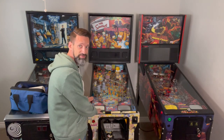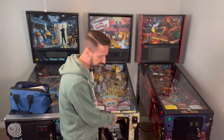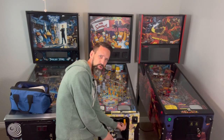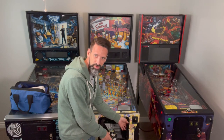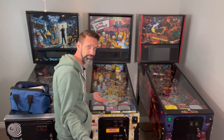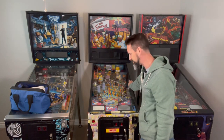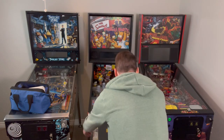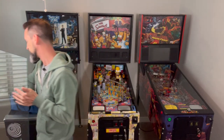The lockdown bar can just get pulled out and put out of the way. Then you're going to slide out the glass, but you've got to close the coin door before you do that or the glass is going to hit it. That's where that spring comes into play — some older machines have lost the spring, so the handle won't stay open, and you won't be able to shut the coin door. Make sure that yellow handle is pushed back, hopefully the spring is pulling it back, then lock the coin door again. The glass has little plastic trays — a guide it slides in and out of — so we just pull the glass out and put it to the side.